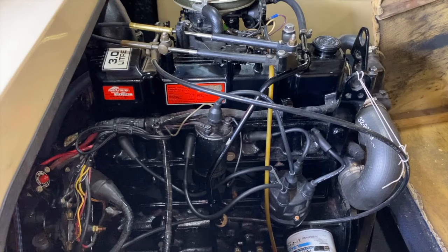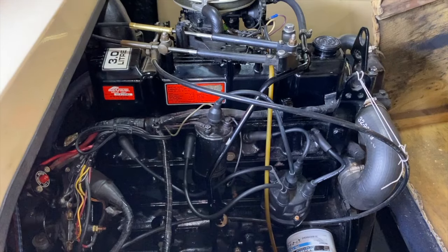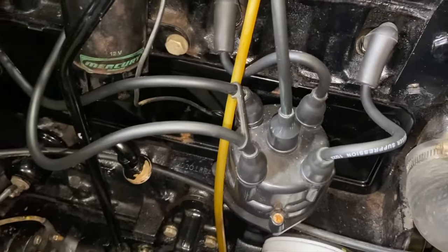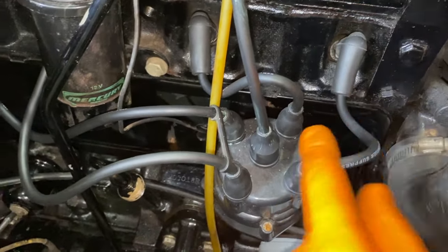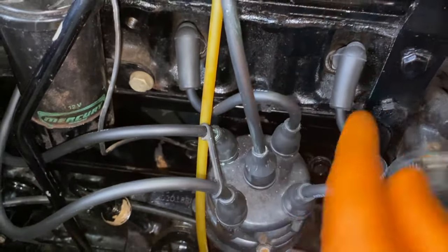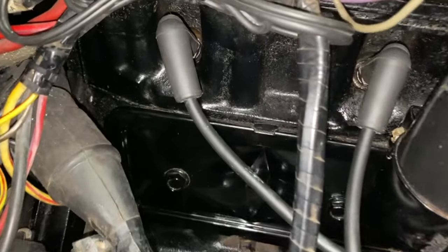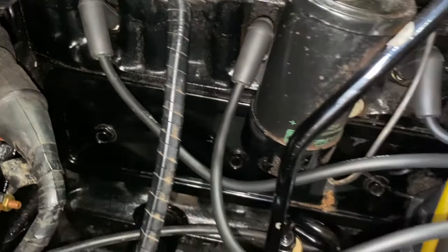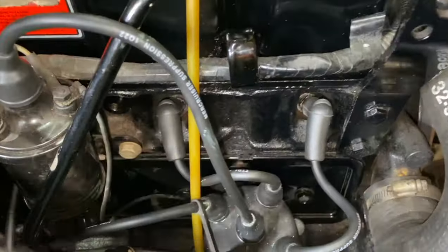If all looks good, go have fun out on the water. Do us a favor — below the video you will see the thumbs up icon, click on that, like the video, subscribe to the channel, and definitely ring your YouTube bell. Thanks again for watching. Now, a close-up recommendation: go ahead and position your spark plug boots on the plugs in a way where the actual wire is not resting flush against or touching the hot portions of the engine — that will extend the life of your ignition system. All of those wires are positioned so they are not touching the engine, as you see there.